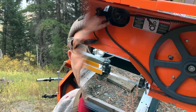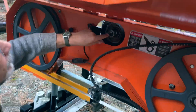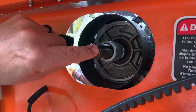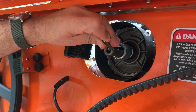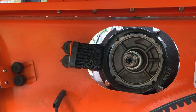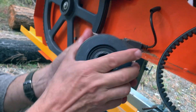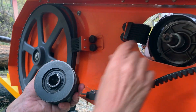Let me turn this unit around and have a look. So you can see in there, there's a little keyway — a little square slot — and this is the key, and you slide that in. We've already cleaned up this keyway and just put a little buff on it. This side goes to the engine, this side faces out, and right here is the keyway that needs to match up with that.